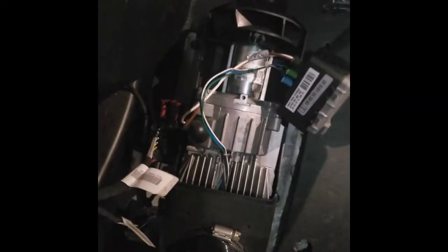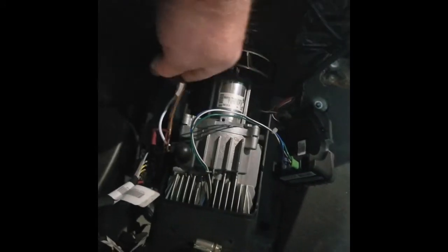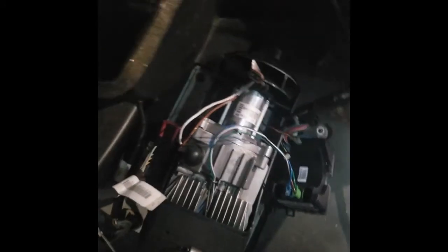With this out, you can see the blower fan, the motor, this control module, and it runs down to the glow pin right here. I'm going to just unplug the glow pin — this is a keyed plug, so you don't have to worry too much about which way it went in because it's keyed. The next thing I'm going to do is remove this rubber seal from the glow pin right here, and these are really fragile. The glow pin connections are real fragile.